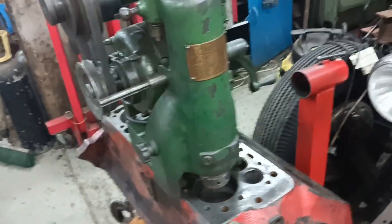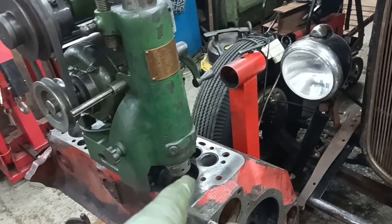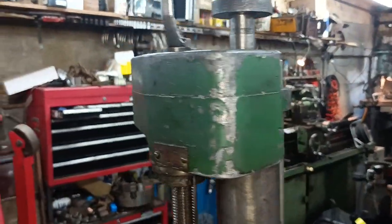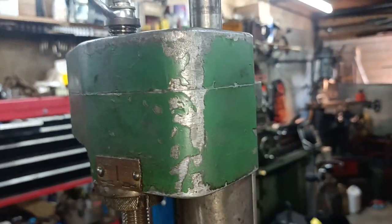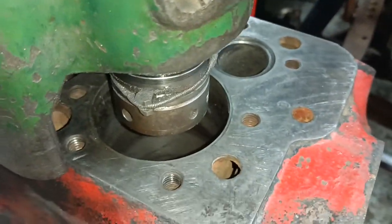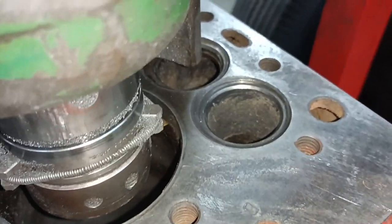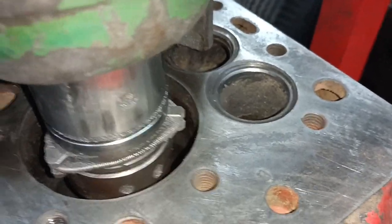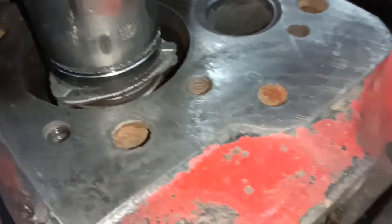So, first thing to do is to centre it. Okay, so this is loose, so I'm going to wind the handle and lower it. I'm winding it clockwise. And can you see that the body is going down relative to that? Rather, the first thing to do is to release the tool so it's not at the cut from the previous bore. That tool's loose. So there, I've just got the cat's paws there.